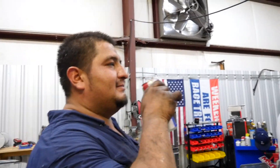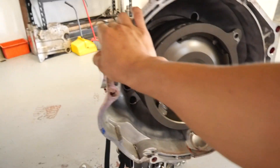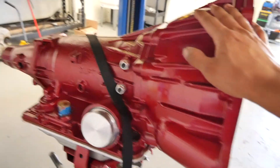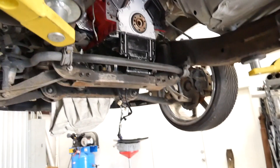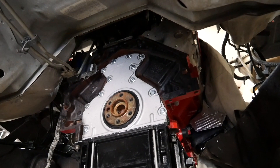Got the truck pulled out. The transmission on it was the wrong one. Now we're installing the transmission on this truck. It's our Stage 2 4L65E with a high-stall converter and our high-rev kit. Engines that rev past 6,000 RPM — like basically every cammed LS — need the high-rev kit. That's where the power is made. Revving a stock cam past 6,000 really gains you nothing, maybe five horsepower.